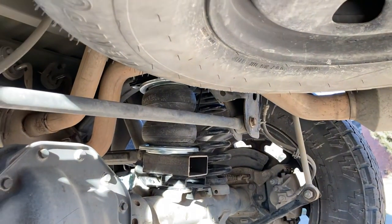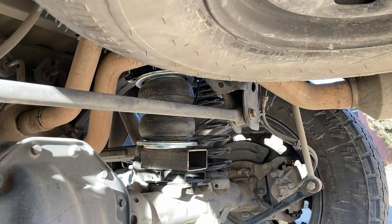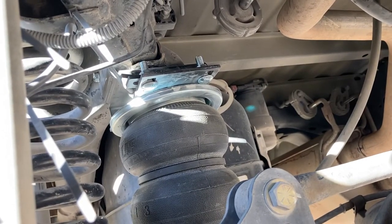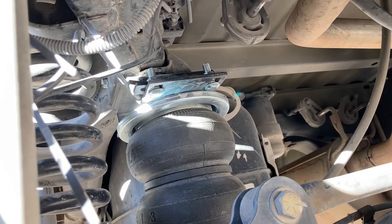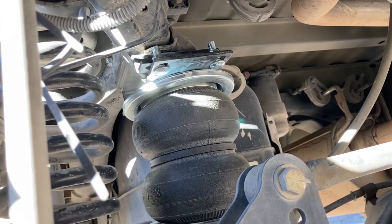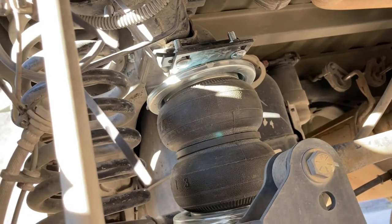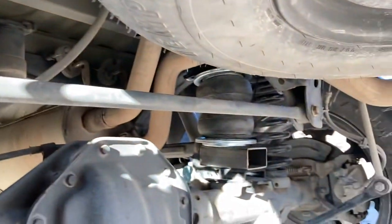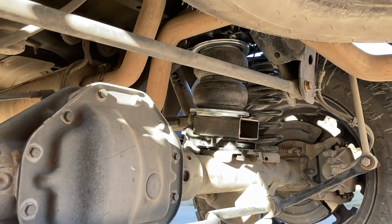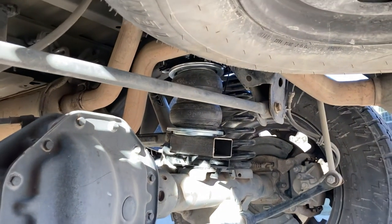If anybody has any questions — I wish I had gotten some install video but was pressed for time and really just wanted to get it done. If you guys have questions, I'll try to help out. I'll have a link to these exact airbags in the description. One thing to note: when I bought these, there is another set out now that actually bolts instead of having to drill holes and cut your bump stops off. They bolt to the bump stop bracket with a U-bolt or muffler clamp. That's what I thought I got — the description said no drilling or cutting — but I got this style, which works great. There is another option out there where you don't even have to cut those bump stops off; you can just pull off the little rubber piece and everything bolts in. But thanks for watching and we'll catch you guys in the next one.